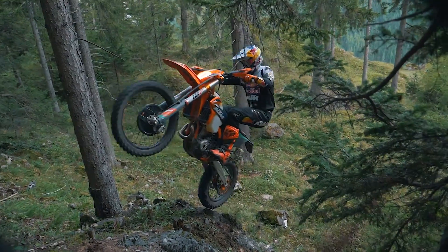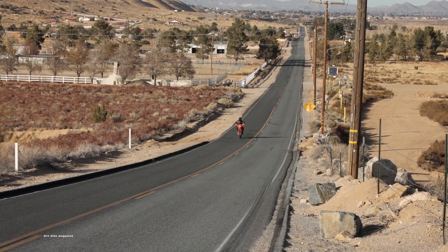We retain that factory map switch functionality, so you can make map one even tamer than stock for hard enduro — really smooth out that power delivery — and map two is your dunes tune, your snow tune, whatever it might be. Those modes selectable on the map switch directly correlate into the Power Vision 3. We can also alter fueling based on engine temperature, so in snow where the engine is exposed to cold all the time, the PV3 can cater those specific fueling changes.